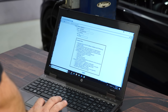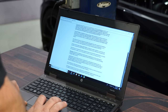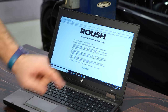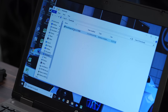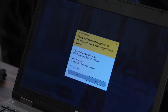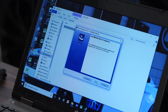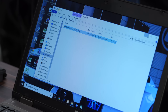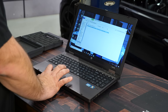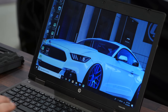Fill out the information, scroll to the bottom, and click Submit. A user agreement will pop up — scroll to the bottom and click Accept, then Submit. You'll receive an activation code — write that down and save it because you will need it. The download should appear at the bottom of your screen; if not, go to your Downloads folder and double-click to walk through the installation. Once complete, click Finish and close that window. Then grab the supplied disk, put it in your disk drive, and install the software on the disk. On your desktop you'll see the Roush Diagnostic Tool — click on that.